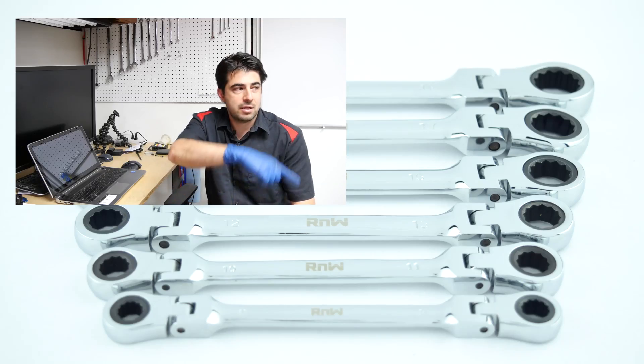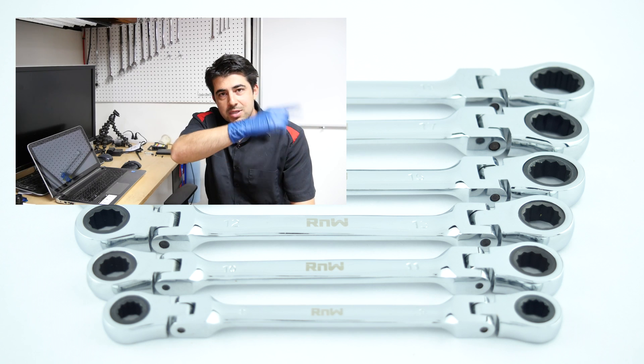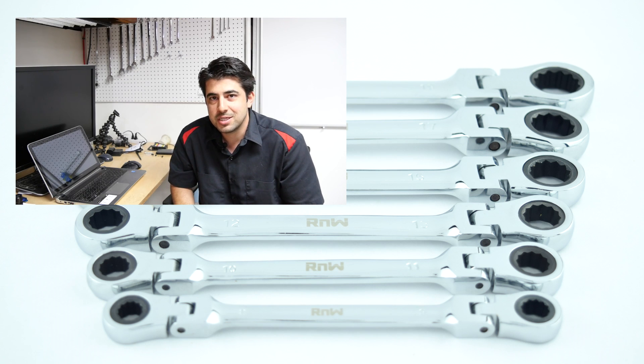So there you have it — that's how you can pinpoint where the noise is coming from so you don't have to throw parts at your car and waste time and money. As we mentioned earlier, putting belt conditioner or rubber protectant on your drive belt or serpentine belt at best has a negligible benefit in regards to the belt's life expectancy. But at worst, it's quite possible it will cause your belt to wear out prematurely, and if you put it on your timing belt, that will cause catastrophic engine failure. So don't do it. Thanks for watching — I'll see you guys next time.